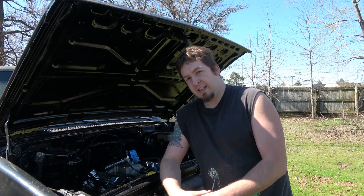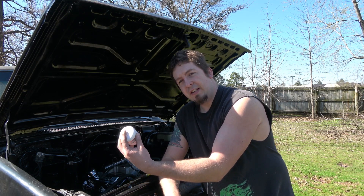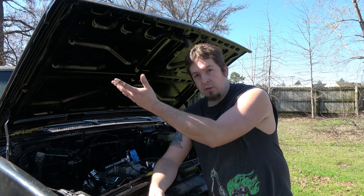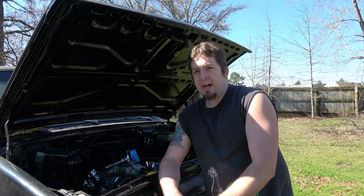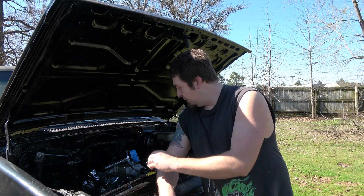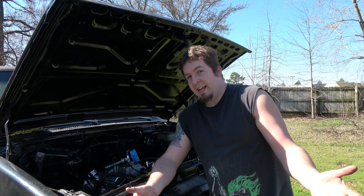You never know, it can come in handy. And they're not very big — they're small, as you saw. I usually already have the thermal paste compound already applied on the spare module and keep it in a Ziploc bag so the paste doesn't get on anything, stored in the console or glove box. That way, if all of a sudden I feel like I ran out of gas, I can check my fuel — if I've got gas, I'll pull the cap, swap modules, and see what happens.